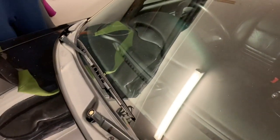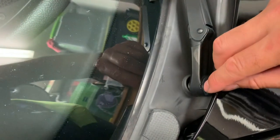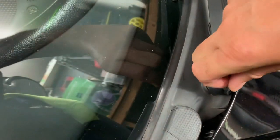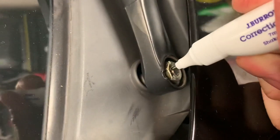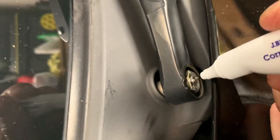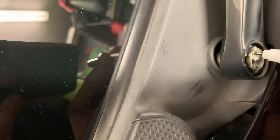We'll get started and remove this old one - just to make alignment easy, you pop off these caps. If you haven't lost yours already, just do it with your fingernail, they shouldn't be on there too tight. Don't lose them. I have a liquid paper pen and we're going to mark on here and on the nut and bolt inside. The nut's done and the bolt's done so we can line those up, and put a bit on there so we can line up the arm right across.